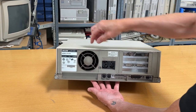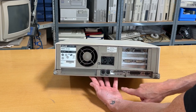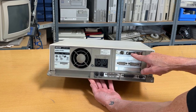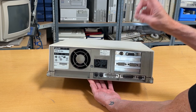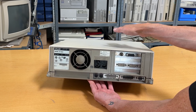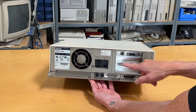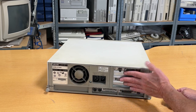This area is the power supply with the fan. We have power in and power out. We have the PS2 keyboard, mouse, and we have parallel, serial, and video which is VGA. Up here I can see we have two cards in it. The first one is an Ethernet card, some sort of network card. I will assume it's the Olivetti branded Ethernet card that actually holds a Motorola 68000 CPU. This other one states A and B — I don't know if this is for joysticks or what. It features four possibilities to expand.